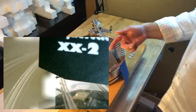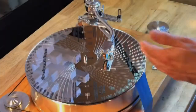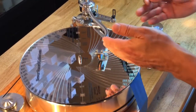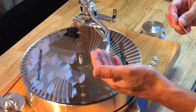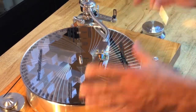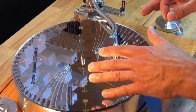It's about one millimeter too far past the groove, away from the pivot point. So now we need to fix that. We've determined that at point number one, the cartridge is about a millimeter or so too far out to fall directly into the arc we've chosen. We do not touch the Wally tractor — as I said, we only move the Wally tractor at point zero. Keep the Wally tractor immobile.